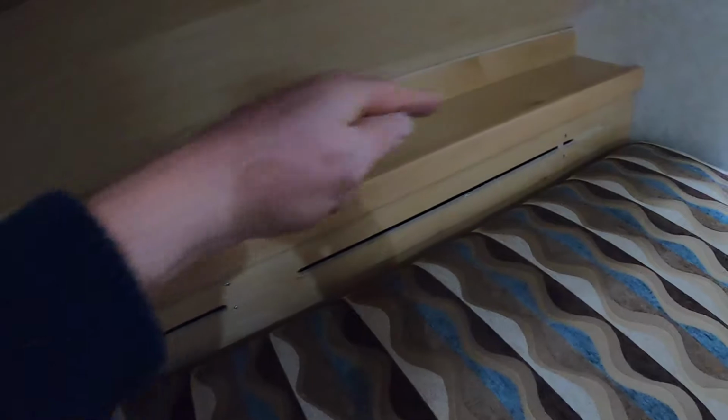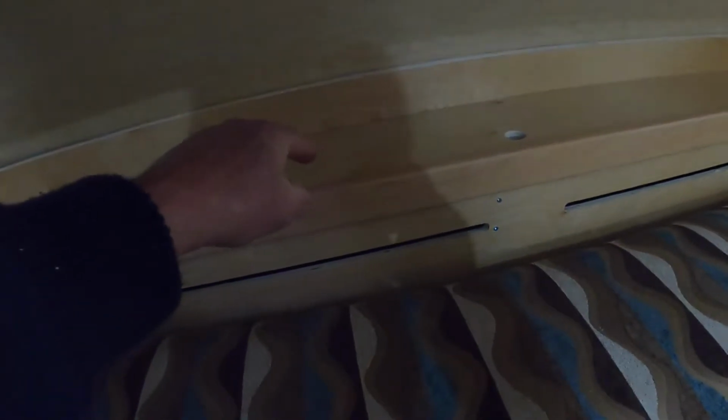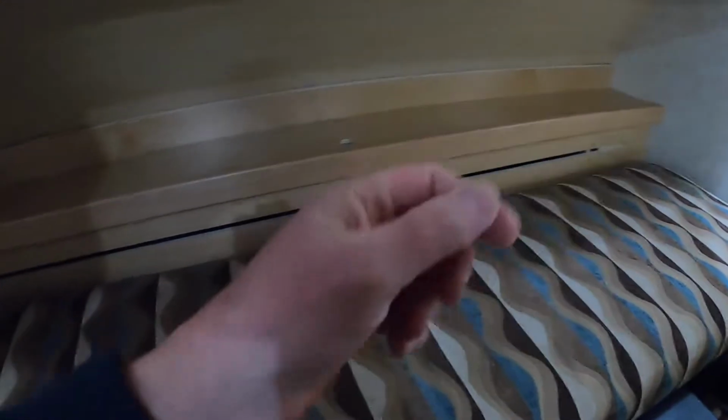There's a really big, in fact the biggest radiator of this entire trailer, back behind there, and it's supposed to pull cool air in from underneath here, heat it, and have it come out here. But if you put your pillows and stuff across here, it blocks most of that heat. So all the heat gets trapped in there and none of it comes out here in the room.